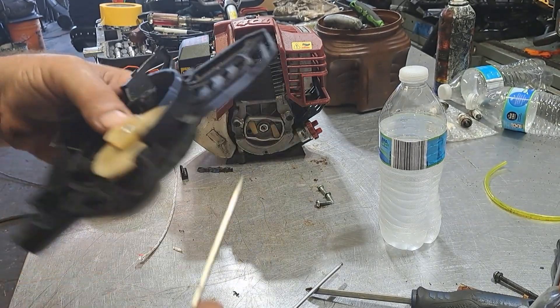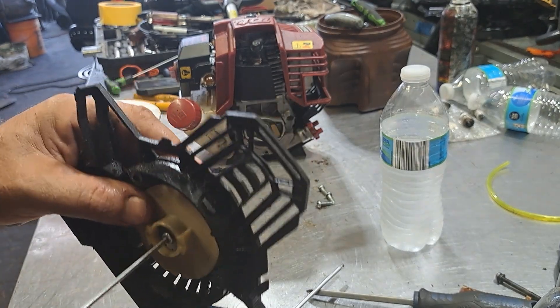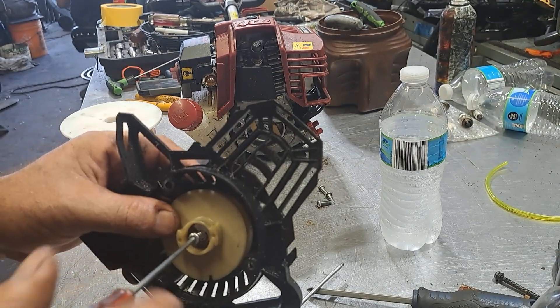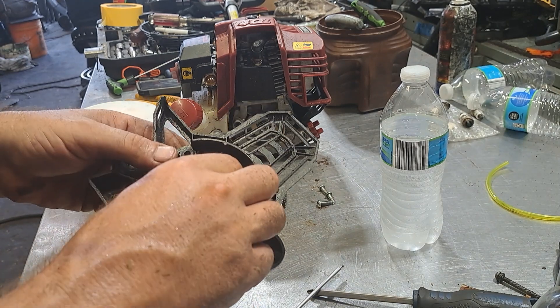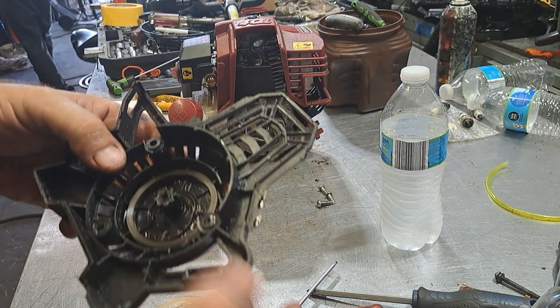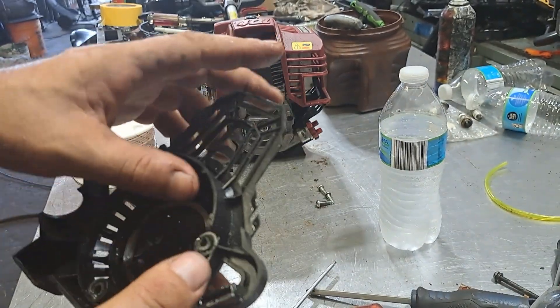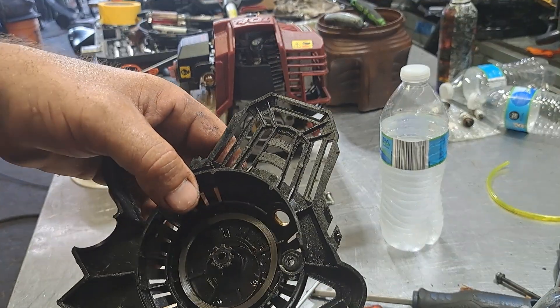So if you have rope left, make sure you cut that rope and release this slowly so that there's no tension on it when you go to take this out. If there's any tension on it, the spring will pop right out. We're going to slowly get that out, and if the spring pops out, you just got to go to the outside first, get it in, just work your way around — keep getting it in from the outside to the inside.